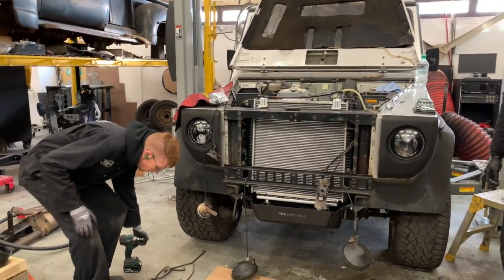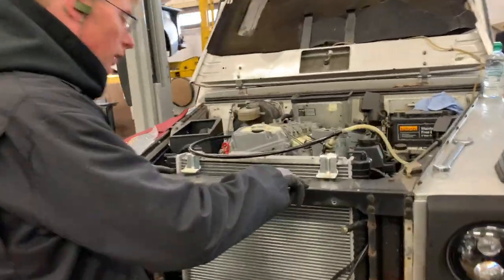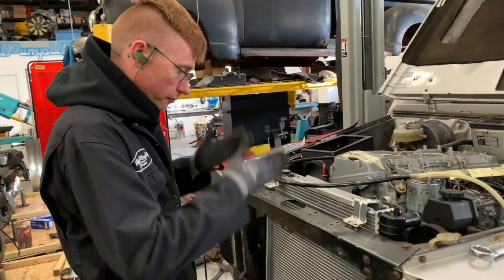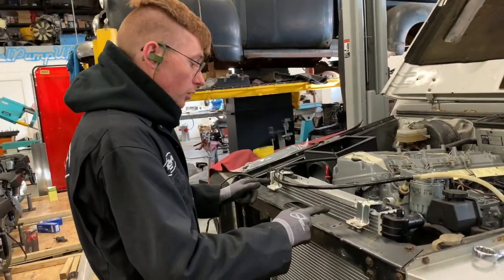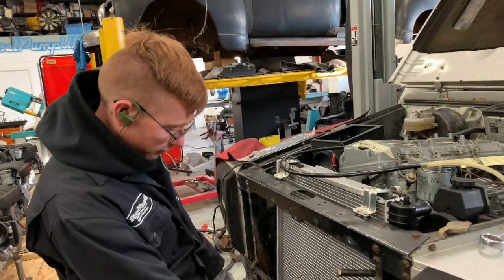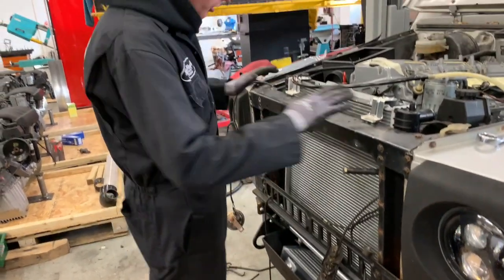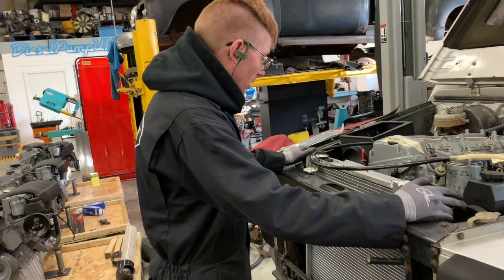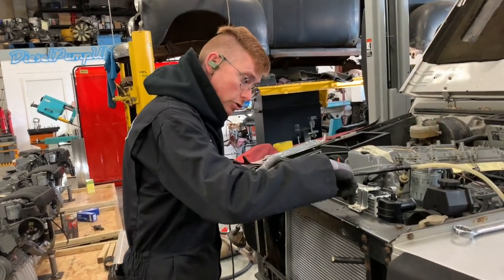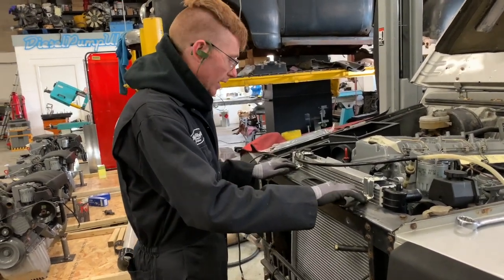Now, the other thing is, obviously, because we've gone 463 radiator conversion, you can see the original mounting bracket holes for the original vertical flow radiator were there. And now, with these 463 brackets, we've calculated the correct height on the bottom mount, so this all sits right. It's a case of getting that where you're comfortable, in the right place, drilling through and literally a nut and bolt before you put the grill and everything on, so that they're nicely down.